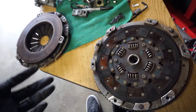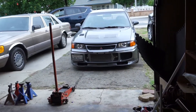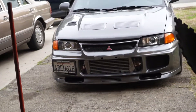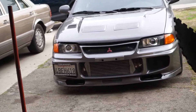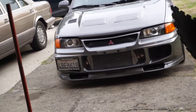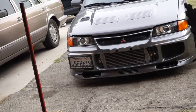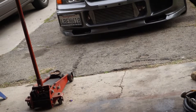What I did was I cleaned all this off on the new one and reinstalled it, but the clutch still had some remnants on it. Since I've gone through every point, I'm thinking the clutch still has some of that green stuff that, after it heats up, is actually preventing me from engaging the clutch. It feels like I lost pressure, but in the mornings for the first 30 minutes even when it's cold it runs really well. For some reason after 30-45 minutes it just goes to crap.